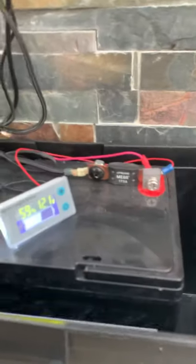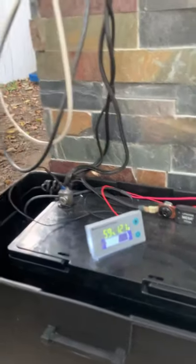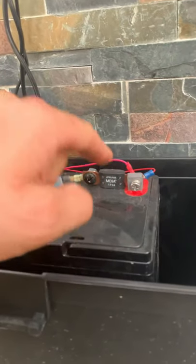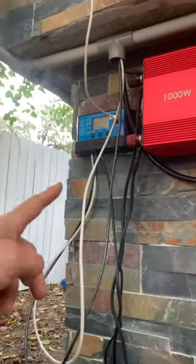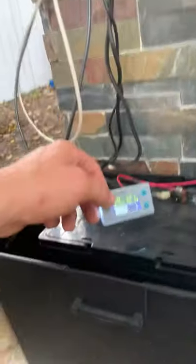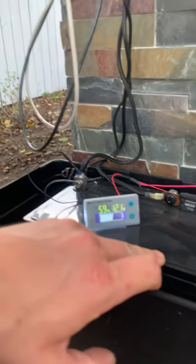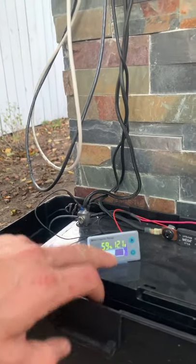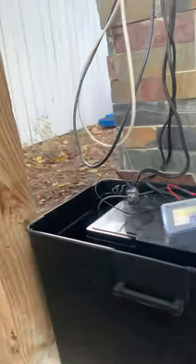So: solar hookup, inverter, controller, control panel, and then I've got my battery hookup — just a simple 12-volt marine-grade battery. I think it's BattleBorn; I can put the link in the description. I rigged up a 175-amp fuse so if something ever goes awry I'm not going to fry my battery — it'll stop it there. Then I put a secondary sensor here so in the event that my battery gets depleted very quickly or I'm taxing it too much, this will send out an audible alarm as well as an alert on the control panel so I can stop and figure it out.